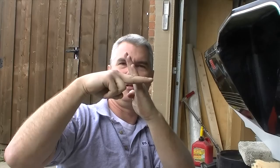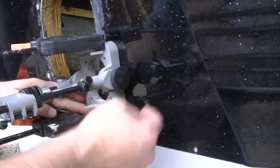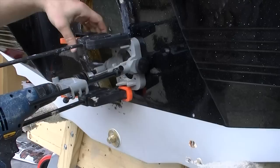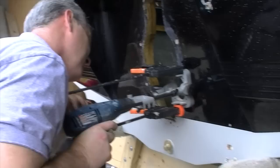So they actually make a jig for it, but I found this at Home Depot and it tends to work okay. So you can see I've got my jig here lined up, and I'm making sure that I have 3 feet touching at all times. It's impossible to get the fourth foot there, but you have 3 mounting locations to keep this jig perfectly level on the transom itself. I just use two clamps to hold it, and we just slowly start drilling. Except when the clamp falls off.